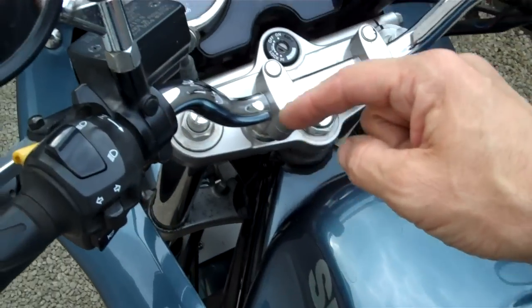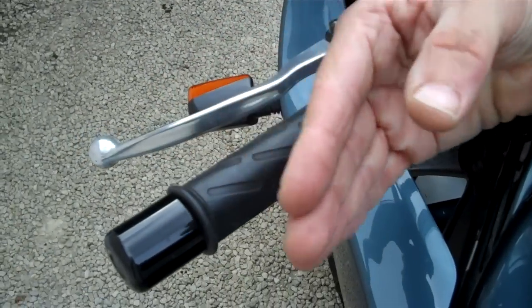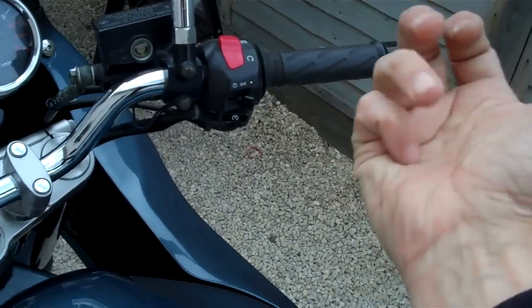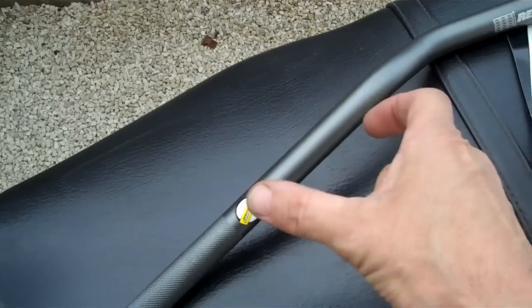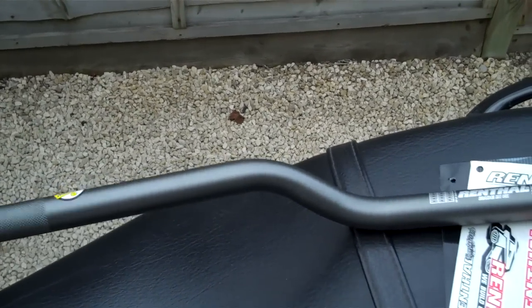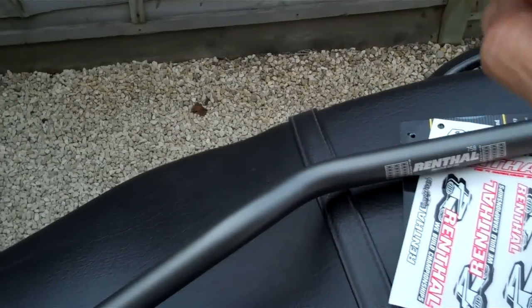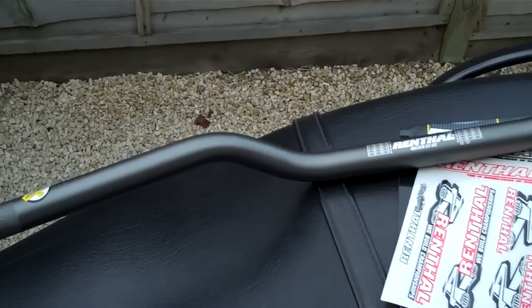They're kind of meant for a road bike. You can get the motocross bars with the daft brace across — great for a motocross bike but stupid on a Bandit. So these bars have too much of a kink here and this angle of about 40-odd degrees twists and digs in the heel of my hand, not comfortable. They're way too narrow as well. These are about an inch and a half wider and a little bit less on the angle, plus they're lower — they only rise about an inch and a quarter. I got them for 25 quid on eBay from Demon Tweaks, best price, free postage as well.